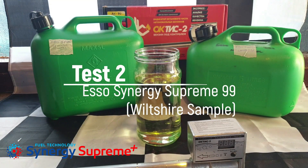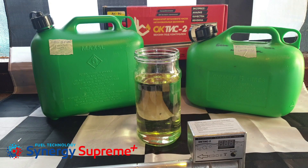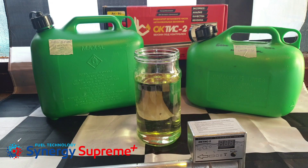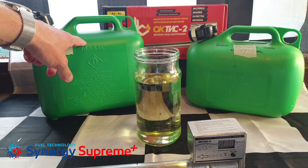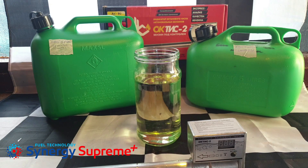The second sample is the Esso Synergy Supreme from the Chiseldon garage just off the M4. I'm not sure about the delivery network — the two garages are probably about 35-40 minutes apart. Whether the tanker delivering fuel to this garage is the same one that serves the Whitney one, I'm not sure. But if this shows 99 octane and above they're clearly from different deliveries; however if it's showing around 93 RON too, then there's probably something questionable with Esso — assuming the other tests I do in a minute don't read over 100.